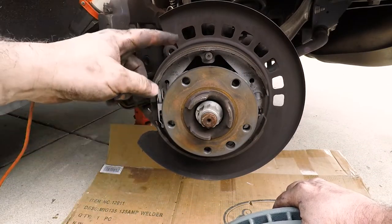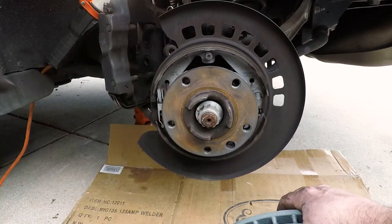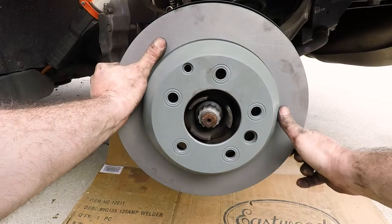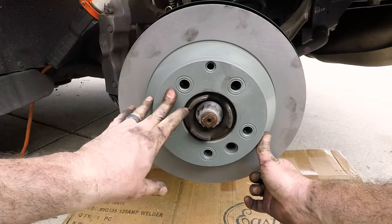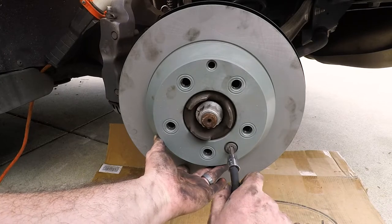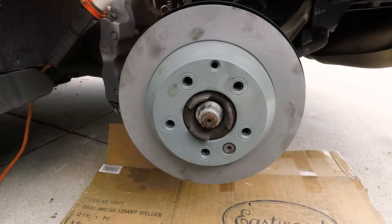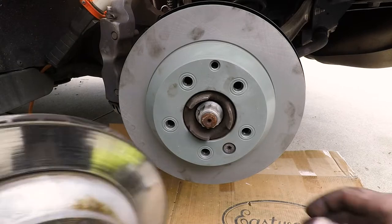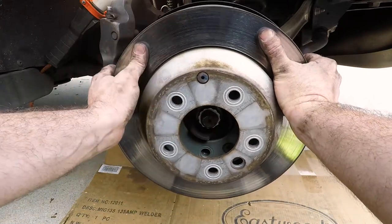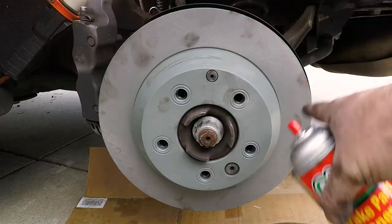This is why we don't hit the emergency brake when working on the rear brakes — the emergency brake works like a drum, and if it was activated it'd be impossible to put the new rotor on. Look for the hole that has a little indent matching the holding bolt, slide it on, line up all the lug nut holes, line up the bolt hole, and put the retaining bolt back on. You can torque it down to 26 foot-pounds. The old rotor has a second bolt in a T27 hole — take that out and move it to the new rotor.